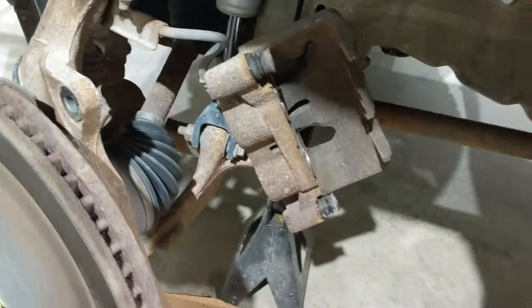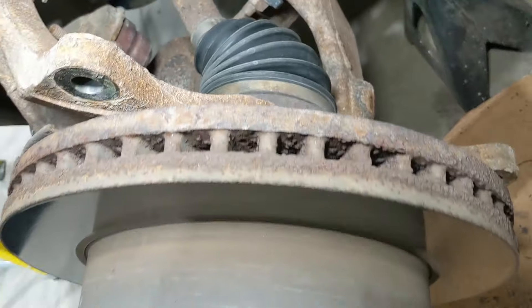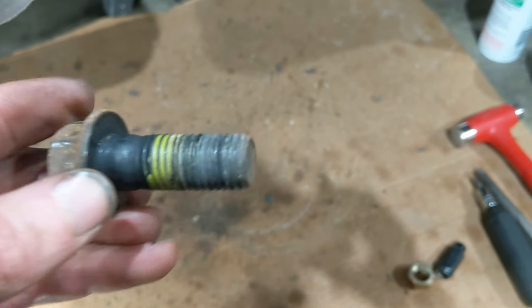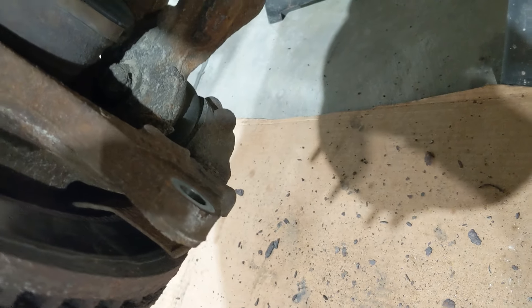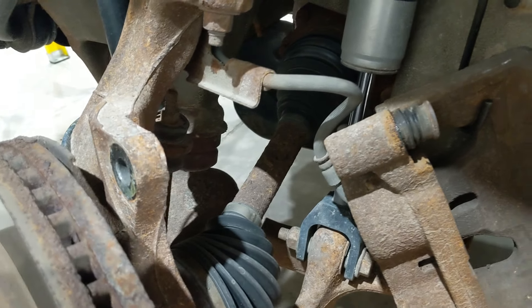As a side note: if you haven't gotten into this job yet on your truck, the bolts that hold the caliper bracket onto the steering knuckle are really, really tight. They're a fine thread M12 or M16 with yellow pre-applied thread locker from GM at the factory, and they are a beast to get out. On the lower side, first turn your steering wheel to full lock in that direction so you've got a better chance of getting tools back there. I was able to use a three-quarter inch impact with a deep socket on the lower bolt.